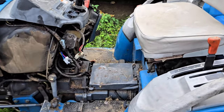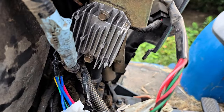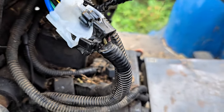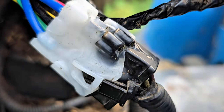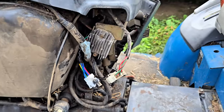Okay, we found what's probably the issue. There's a new voltage regulator there, and coming down from it — melty melty — melted wires. That doesn't make me happy.